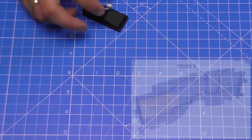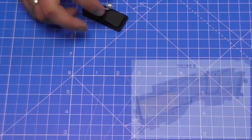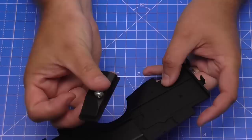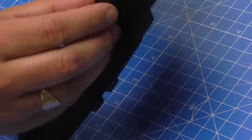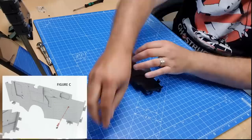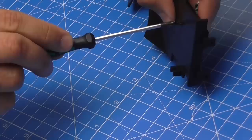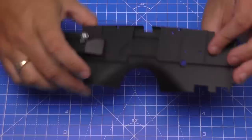There we go, that's into place. Now we're going to actually put this onto the bulkhead. The flat end goes over the top — we have a lug to locate into the pin there — so that's going to fit on just like that. Then we secure it from the other side with an IP screw. Nice and tight. The blower unit is now on the bulkhead.